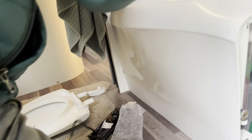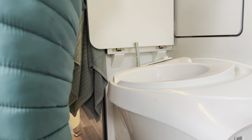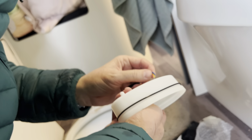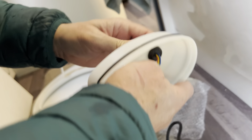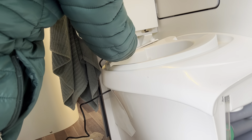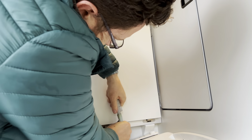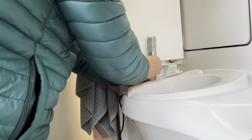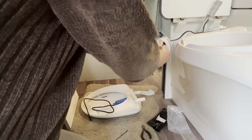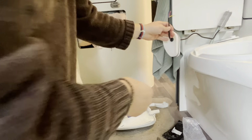This one should twist off, which it does. I'm going to pull that off the kidney bowl and push this new one back through. It fits perfectly - it's the same size. We're going to get a little cable tie and cable the two together. I've cut the cable down so it's the same length as the one that came with the Thetford, because you don't want the cable wrapping up underneath here and getting in the way of the circuit board.